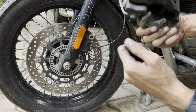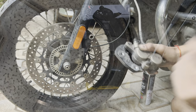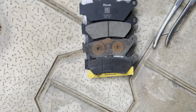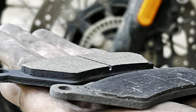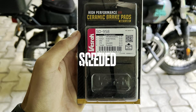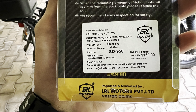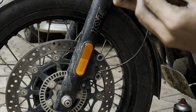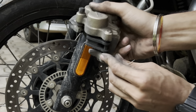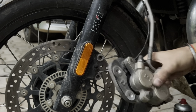These look fine — no cuts anywhere — so I'm not going to address that now. Just going to put the new brake pads on. These are the new brake pads and these are the old ones. Make sure you put the pin in before mounting it back. Yeah, this is the correct way. Let's put this back now.